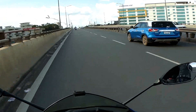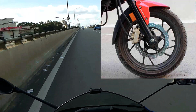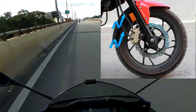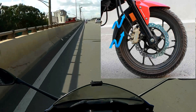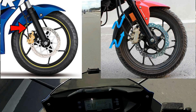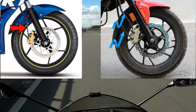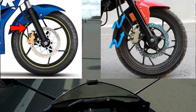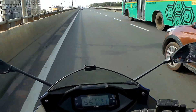How do you identify whether a bike has CBS or not? Take this Honda Hornet as an example — if you look at the front disc, you'll see there are two wires or pipes going to the disc rotor. Whereas the Suzuki Gixxer SF doesn't have CBS and has only one wire going to the front disc rotor. Why two wires for CBS and only one for non-CBS?